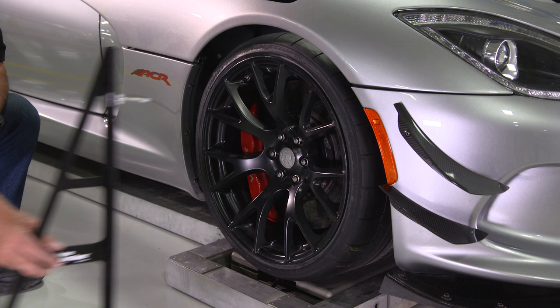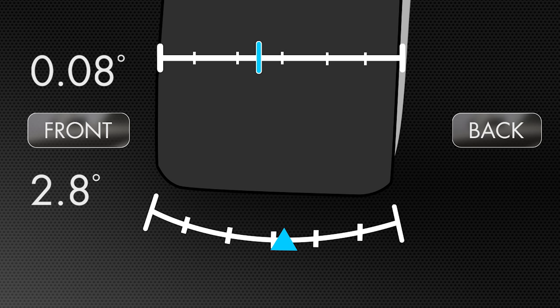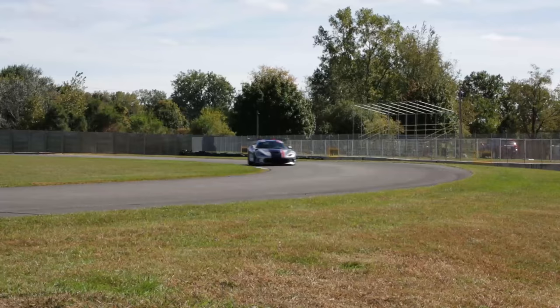Finally, let's check the alignment and the bump steer. A good starting point would be 2.8 degrees negative camber with 0.08 degrees toe out per side for the front, and 1.8 degrees negative camber with 0.11 degrees toe in in the back. This will provide consistent, stable performance and optimized tire wear at most tracks. They might not be the final readings, but they're a darn good place to start. As for bump steer, once ride height and alignment are set, the bump steer should be as close as possible to zero as the suspension goes through its travel, to provide predictable and symmetric handling.